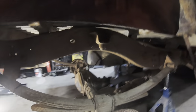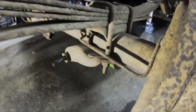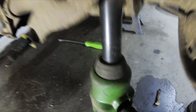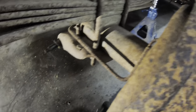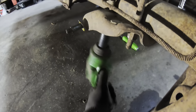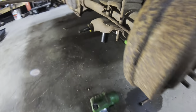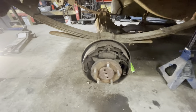Once you get the shocks unbolted and out of the way and your e-brake cables are off, you can move on to the u-bolts - they're a three-quarter inch nut on there. You can try and impact them off or use a breaker bar. If your brake drum's off it's always good to inspect your brake shoes and make sure they're not running metal on metal - like mine, which is... good... makes for easy burnouts.